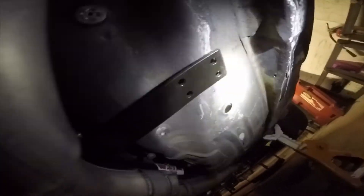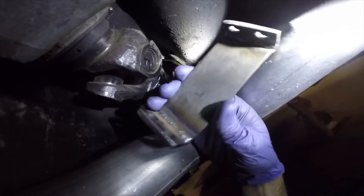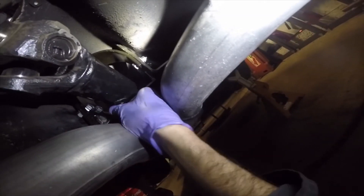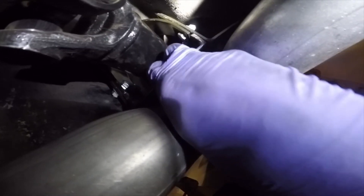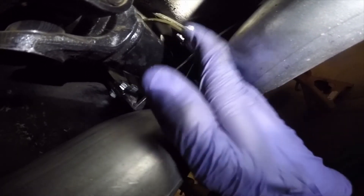We've bolted this back in on this side, kept this side still in — you have the top hoop up there and this side is bolted in. We put this bar back in, it comes all the way over here, and now we're going to mark this side just like we did the other side for the two holes and drill right through. With this side mounted, we take our custom plate that we built to clear this and check the fit — it fits in there pretty well, about an inch from this and an inch and a half to two inches from the drive shaft itself.